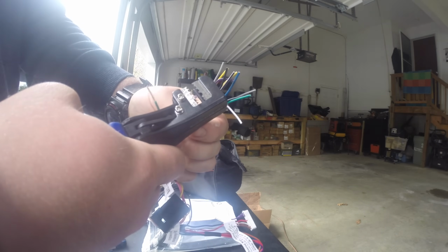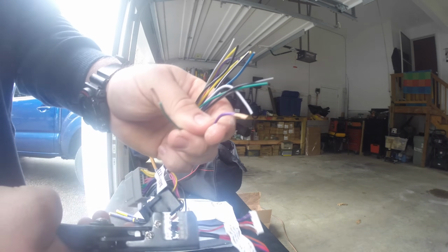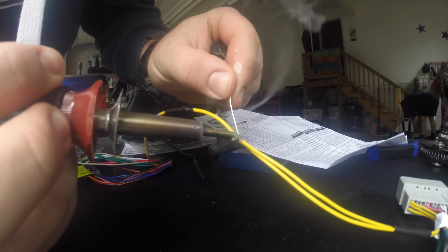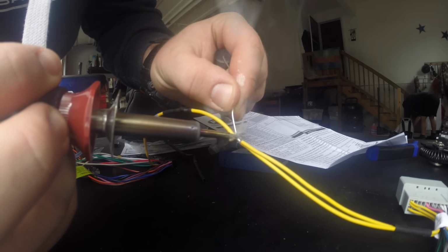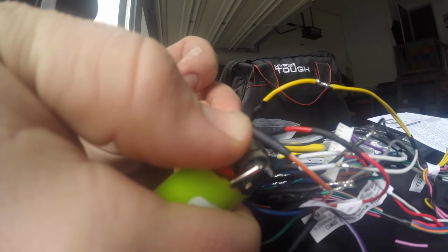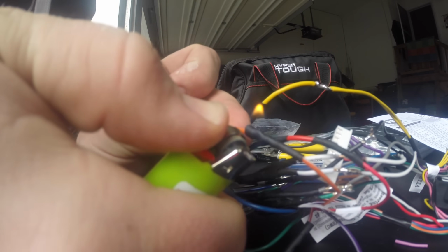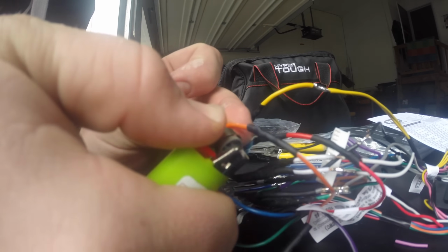Now all you actually have to do is take wire strippers and strip, twist, and plop some solder on there, matching the wires by color. If you desire, you can always use shrink wrap tubing. Make sure you slide this on the wire before you connect them together, or else it's going to be kind of annoying. You could also use tape.